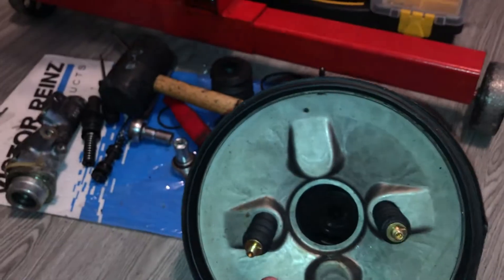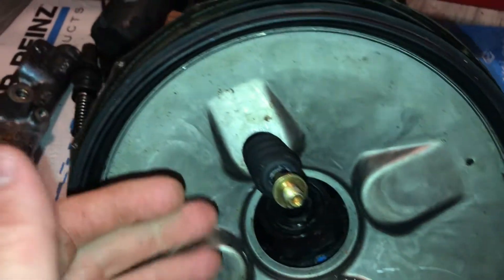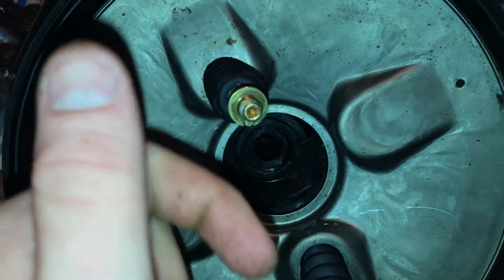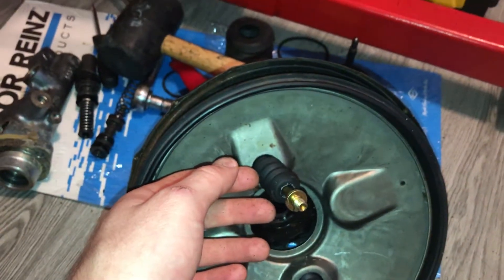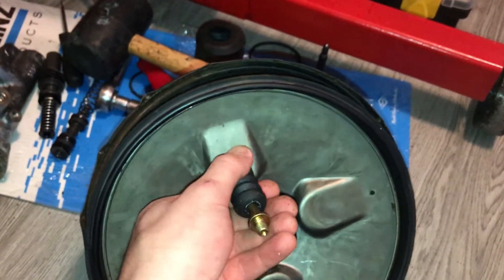You've pressed the pedal. That means engine vacuum is here, but not behind it. It was before you pressed the pedal, but as soon as you press the pedal and that seal engages, it's going to shut off the connection between the front and the back halves of the diaphragm. So the front half is still going to have engine vacuum, and the back half is only going to have whatever it can get. As soon as you press the pedal, there's going to be a tendency for that vacuum to be replaced if there's a higher pressure outside with a way to get in.